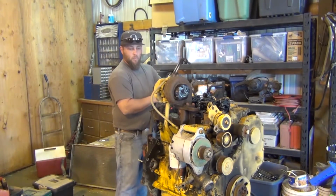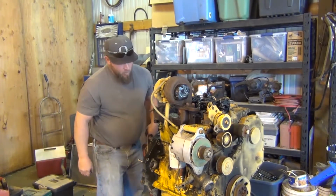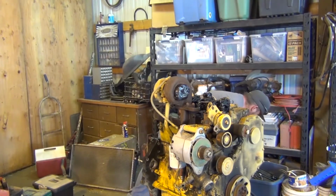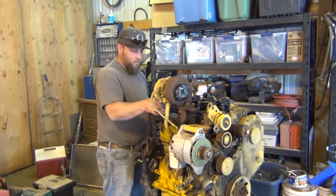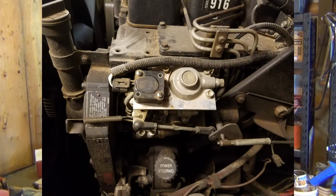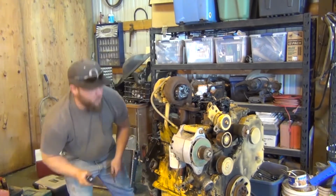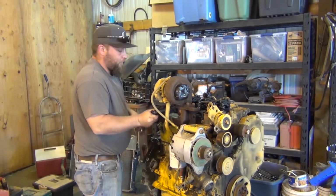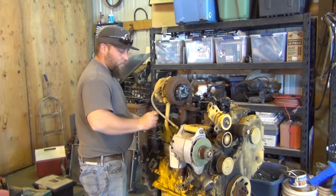Transmission controller, we've got a couple we're looking at, to regulate the shifts, because we're going from the throttle positioning sensor to something else. We're going to have to make an adapter, which I have a picture of, and we're going to show you that adapter right now. And if we can't make an adapter, we can buy the remote TPS sensor kit from TCS. That's not a bad idea. I think the transmission controller that I'm looking at comes with it, because it has accessories included.